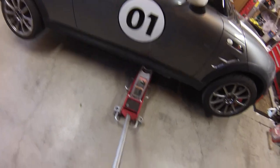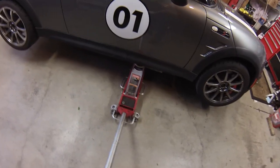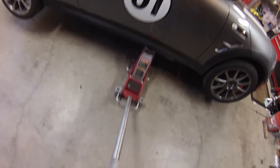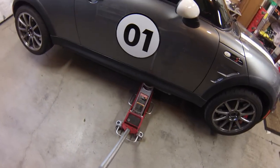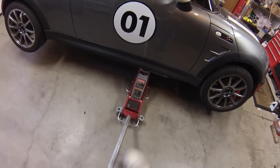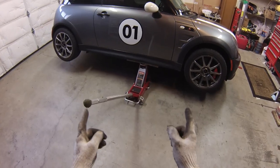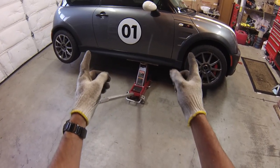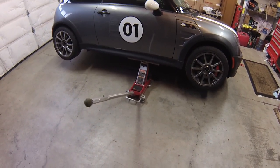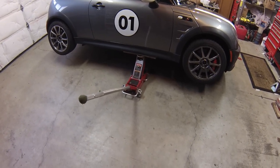You can use a two by four. If your car is slightly lowered you might need a little bit thinner piece of wood. I'm using a piece of outdoor wood — you can find this at Home Depot or any hardware store — and it's about an inch thick, a little bit thinner than a two by four. As long as you have a long piece of wood about this long or longer, it distributes the weight along the rocker panel and allows you to jack the car up with no damage.